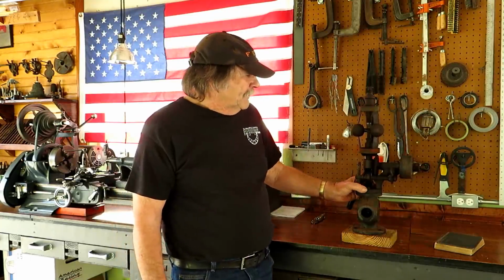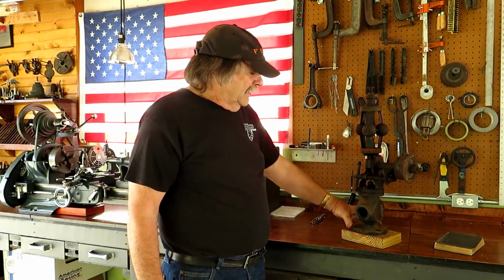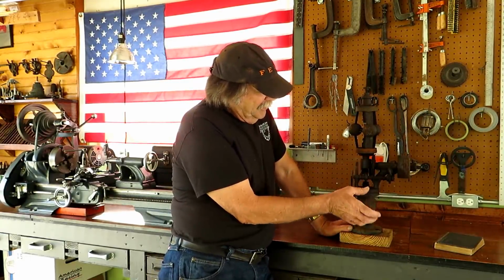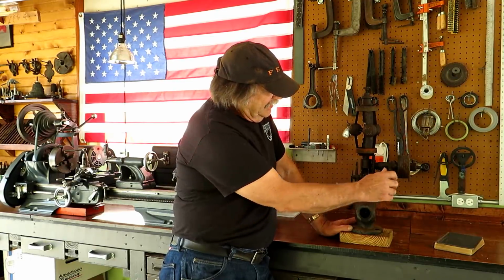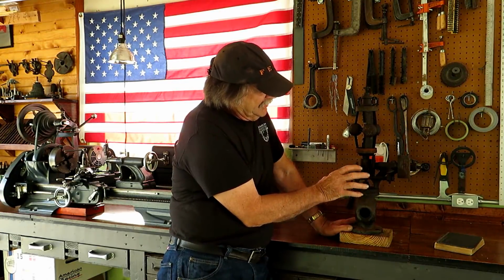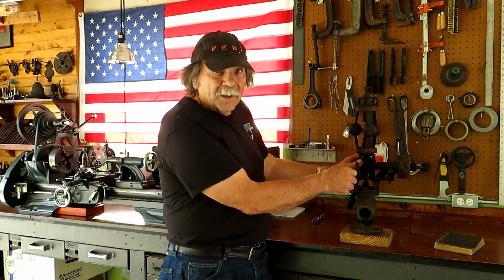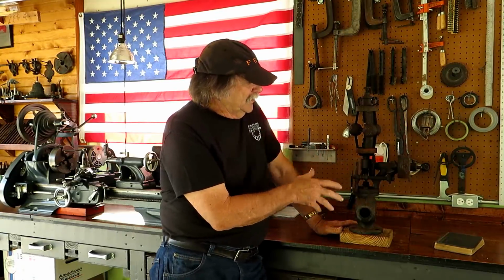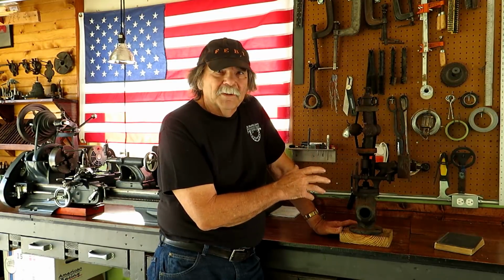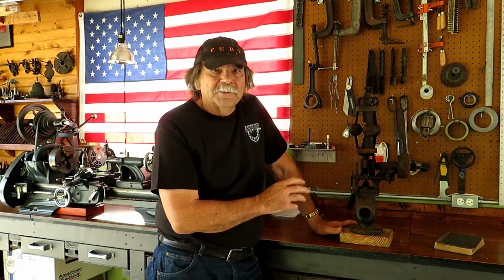And this one is very similar. It's just a little different style. At one time they built both styles at the same time, but it doesn't have the automatic shutoff deal with the idler. It's got a worm gear driven gear here that tightens up on this spring that slightly affects the speed of the governor. The real adjustment is up here on this one. It doesn't have the ball ranger like the one I did last year. But I'm not going to go through this in great detail because it's just like the other one, but I will show you if I find something that's different about this one, some detail on rebuilding it. Probably start in the next video.